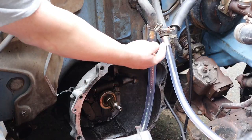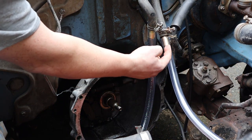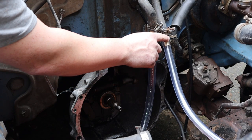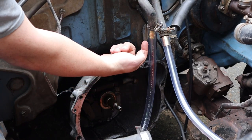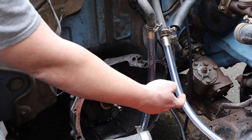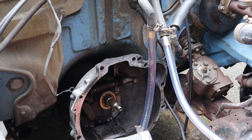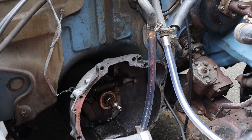So let's get started. What I have here is a vinyl tubing hooked up with a splicer, 5/8 thick inner diameter. Your car might be different, but the coolant normally flows this way and out this hose. It's different for every car again, but this time we're having to go the opposite way. I have the other end of this hooked up to the garden hose with a little adapter that you can get at Home Depot.